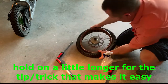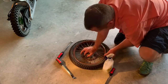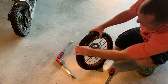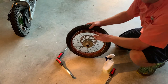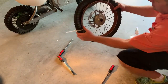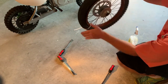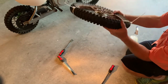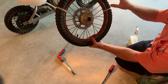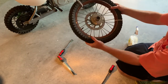Place it in the wheel like this, hold it through, put the wheel on as much as you can. The last little bit is going to be the hardest part. Here's the trick: take two zip ties and zip tie the tire to the wheel where it is fully seated. That's the key — so you're not chasing the bead around when you work the other side.